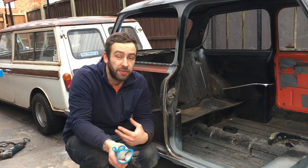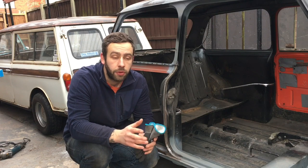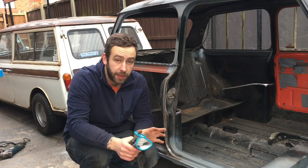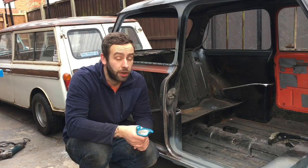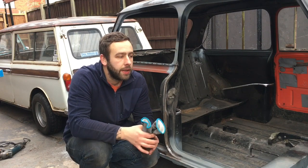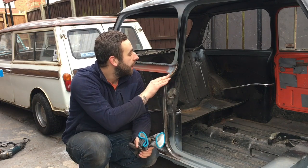So I'm obviously going to have to make a little piece to go in there. I'm not going to replace the whole arch - it's absolutely pointless for a section about that big. So I'm going to have to make that up. But other than that, I'm really quite chuffed with it. I have sort of test fitted the panel and it fits quite nicely up there.